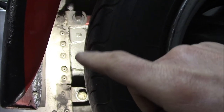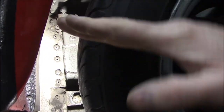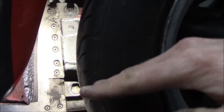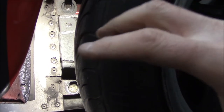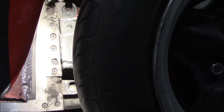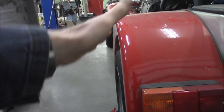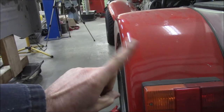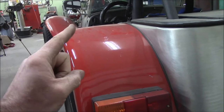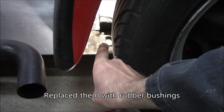The problem is over there. In the back, a non-compliant bushing becomes a problem. These trailing arms can pivot up and down around that pivot point. However, there's another component of suspension happening here. If I hit a bump, yeah, it goes up and down and those bushings will work. But if I hit a one-wheel bump, those trailing arms have to kind of do this, and those bushings will not allow that at all. This car was actually an oversteer handful with the plastic bushings in the back, and I took all of them out except for that bottom bolt right there.